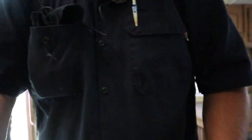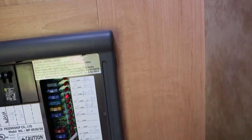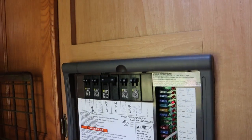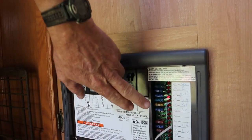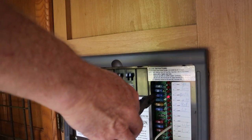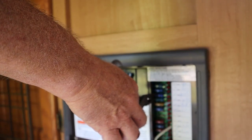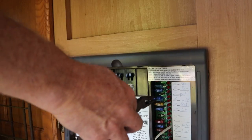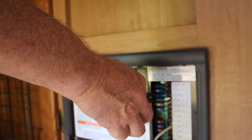The second thing I found was we have a bad fuse there. Can you see that little LED light glowing red? One of those 15-amp fuses is bad. I wonder if it's got a bad contact — the light went out. This fuse is good. Okay, the fuse was not bad, it was just not making good contact. Pulled it in and out a couple times and it seems to be okay.